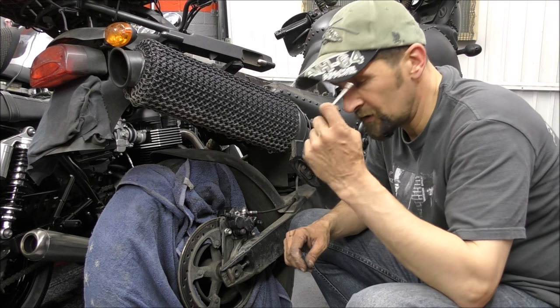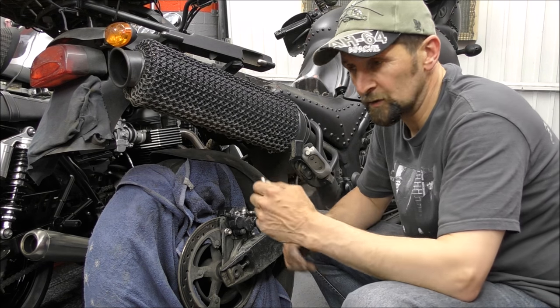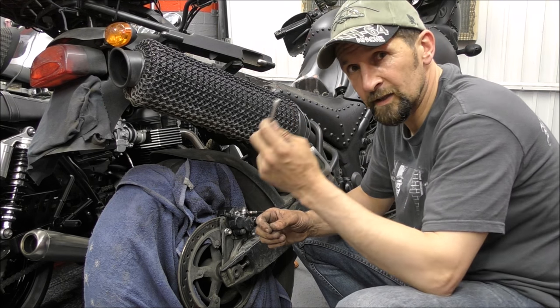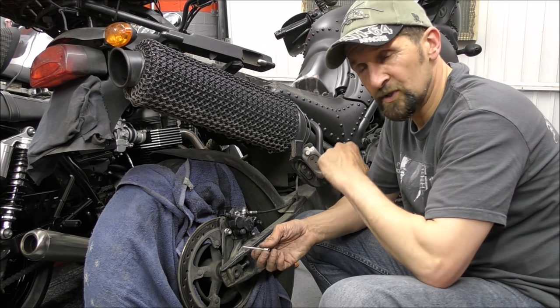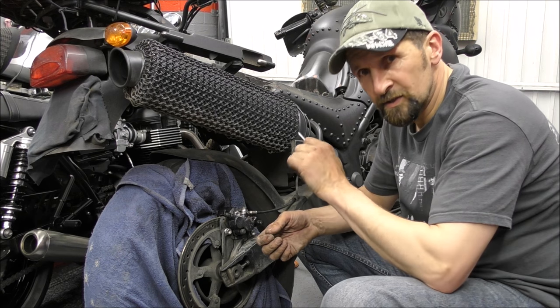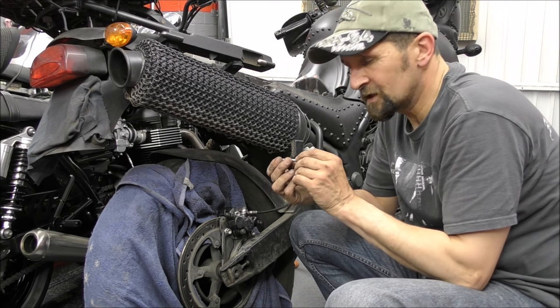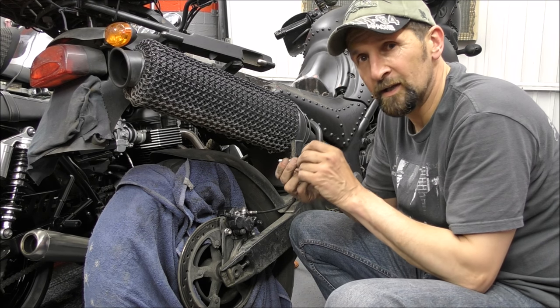This was a trick to show you how to get these brake pins out. You can weld it on. If you haven't got access to a welder, which many, many people don't, then JB Weld is a good alternative. And the trick, as I've just said, is once you get it moving, don't just lean on it, just gently, just do it with your hand. Even if you have to sit there for 2 hours, you'll get a 20th of a turn more on it every time. Go back and forth, a bit more brake cleaner, back and forth.